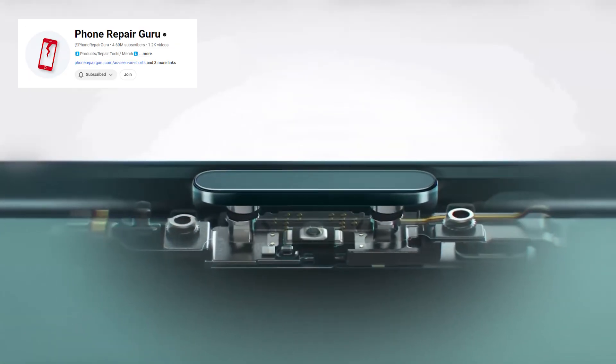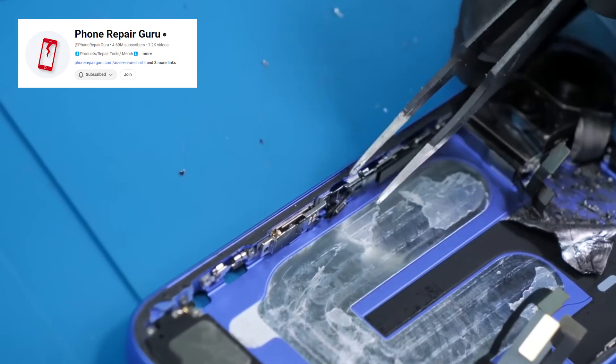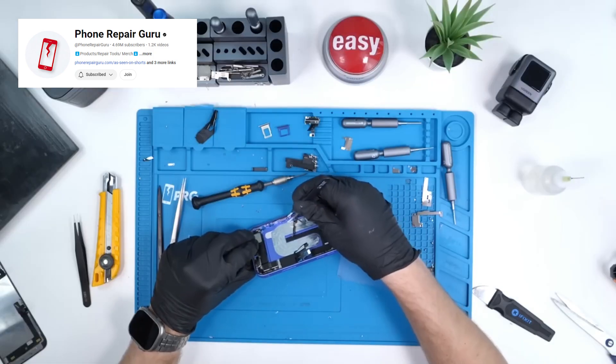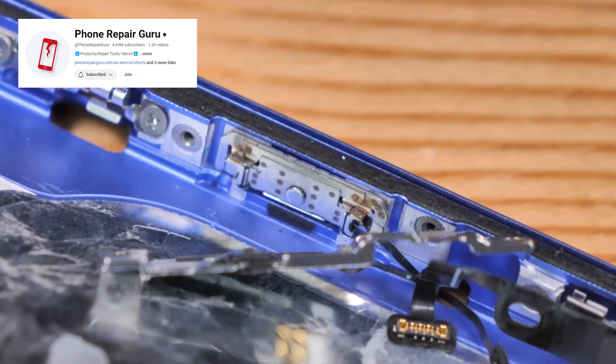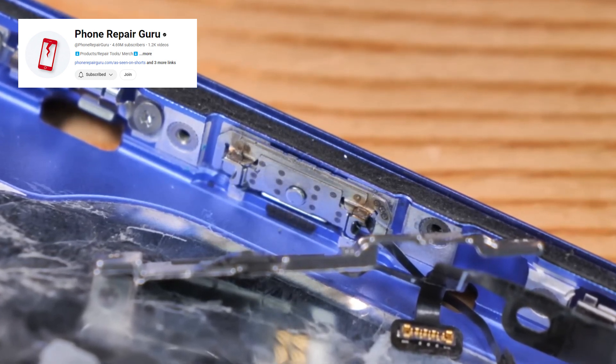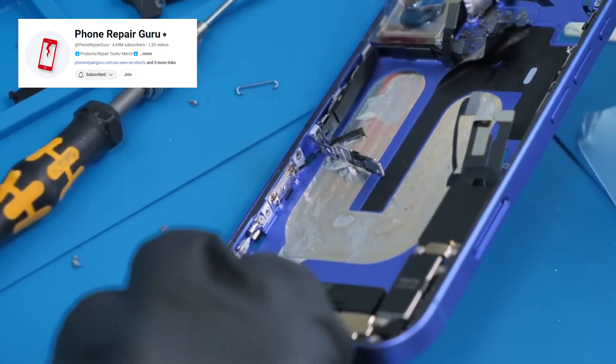One thing to note is that the camera button has been tack-welded into the frame. It's held in by a few Phillips screws and a few brackets, with a tiny connector likely connecting the capacitive side of the button to the tactile switch side. After messing with it, there's no feasible method to pull it out without breaking it — it's just welded in. If you can't replace this, that's concerning. It would be possible to carefully grind away the tack weld points, but it's definitely not practical, and replacing the whole housing will cause issues since the phone registers if the housing has been replaced.